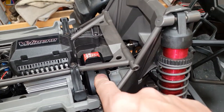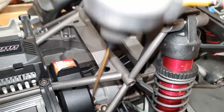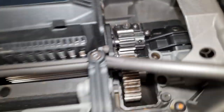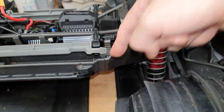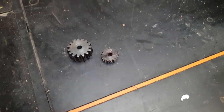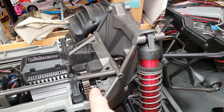On one of my water crossings I did have steel gears in here - a steel pinion and steel spur gear - and I stripped them twice. So I'm now running these Mod 1.5 gears, which are supplied by Wheel Hobbies. I'll put a link to where you can get these down below. Here's a small comparison of the Mod 1 gear the X-Max comes with versus the Mod 1.5 gear that Wheel Hobbies supply.